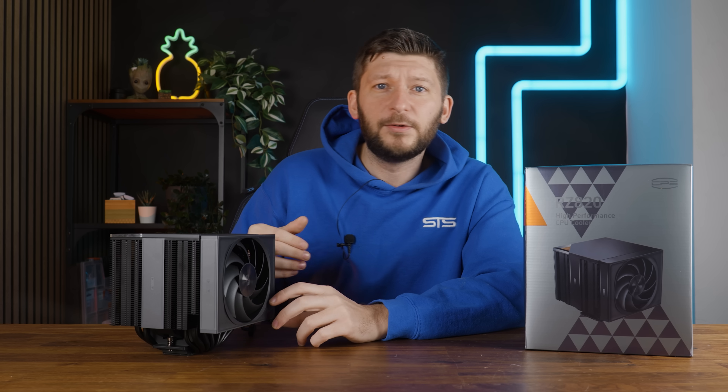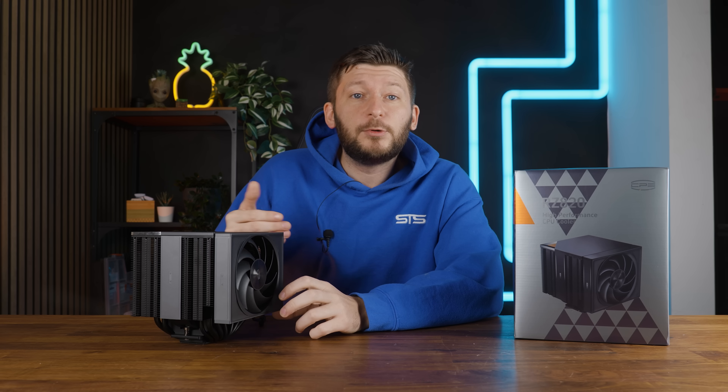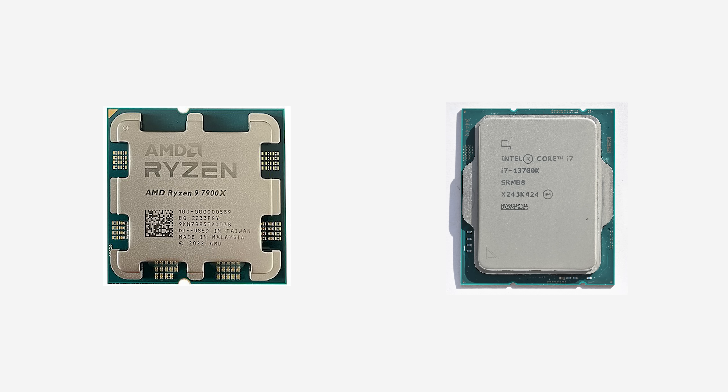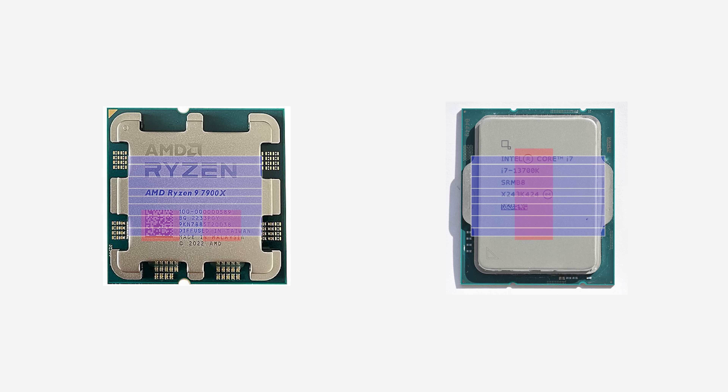For AMD, this is going to be a really interesting one, because AMD CPUs do not look like Intel ones underneath the IHS. Where Intel has a long centered chip — meaning the main heat comes out somewhat in the center, where the two thin heat pipes are — AMD has everything moved towards the bottom. And without an offset mounting in the box, that heat is not going to come out where the cooler thinks it's going to.